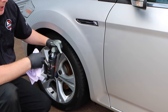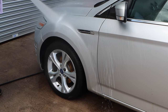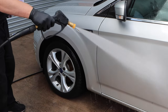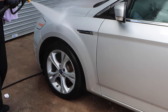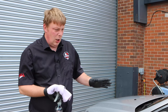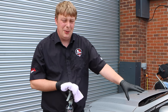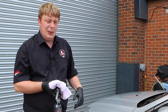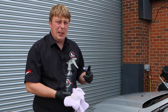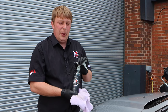Because it's a solvent you want to make sure you rinse it off thoroughly with water afterwards. Also rinse the adjacent panels as well, because when rinsing it can push the product onto other panels, so give it a thorough rinse. Just The Tonic can also be used on glue residues — things like badges. If you're removing badges from a vehicle and you've got sticky residue left behind, it works perfectly on that.